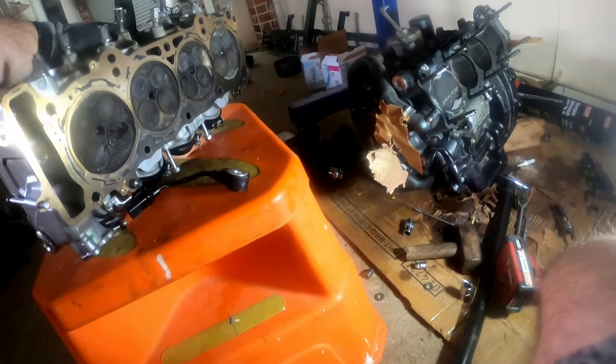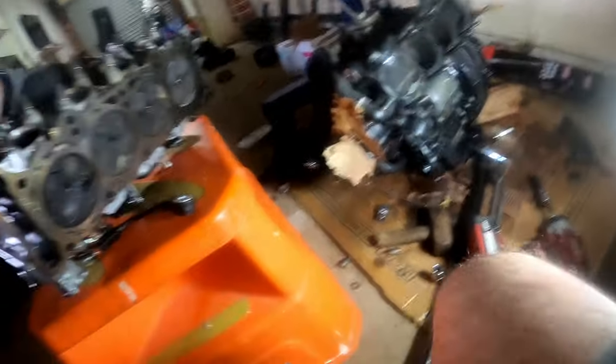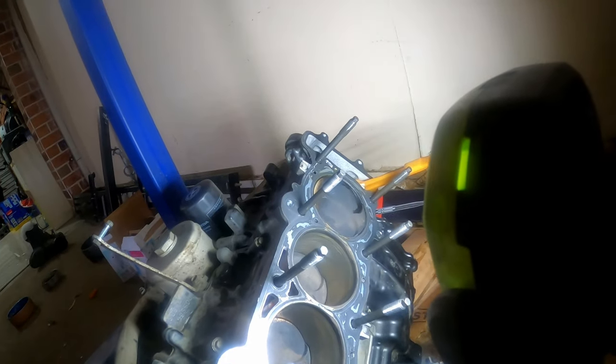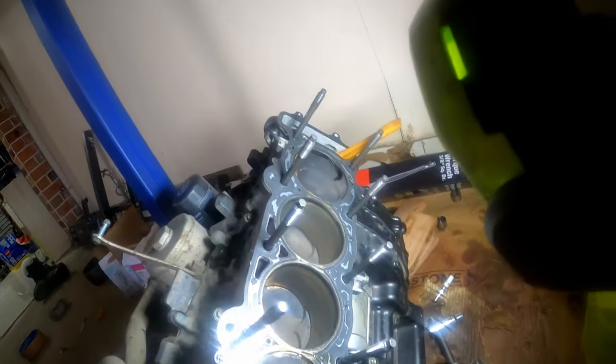Here's the head — I don't know what condition that's in, it doesn't look too bad, it could work fine. But what I'm more interested in is the pistons. You can see some scoring — scratches — but that almost looks like it's machined, like some cross-hatching. You can see it sort of rubbing off here. Not sure what this is telling me, so keep opening to find out more.